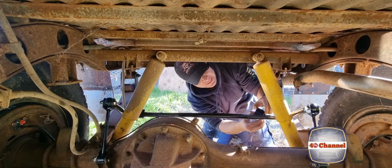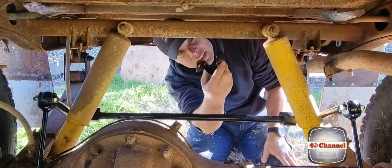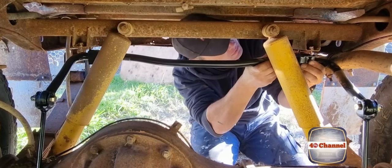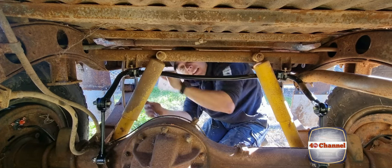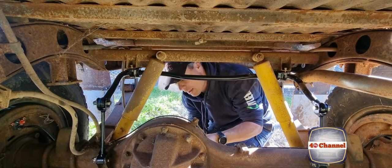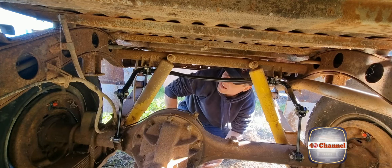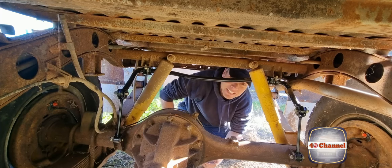Open up the bush with the split in it and force it over the sway bar — just like that. Spin it around, slide it into place and lift her up and bolt her up. Just make sure that the little dimple in the bush is lined up with the metal support. That's it — sway bar's all hooked up. All new polyurethane bushes from Polytuff, hardware kit from Online Auto Parts, and it has come up an absolute treat. There's no reason why this won't last another good 10-15 years.